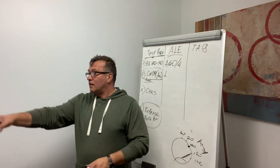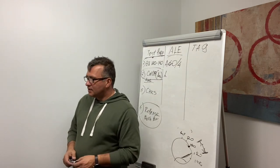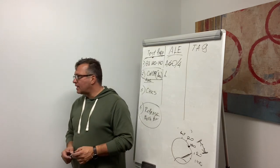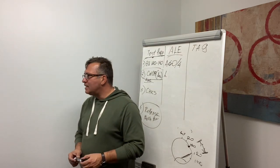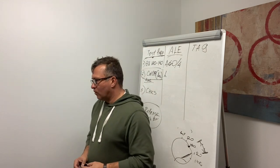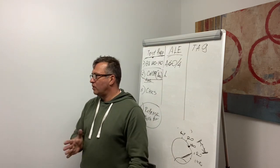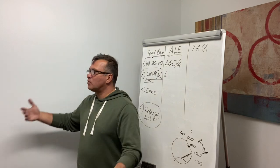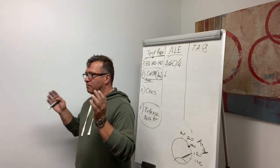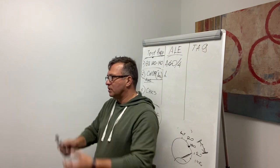The buzzer and light. Outstanding. Buzzer and light. Beep. And a light on the dash. That's the low air warning devices. Nothing has happened yet. Your system didn't engage your parking brakes yet. But it's letting you know, giving you the buzzer and light, that something is wrong and the system is losing pressure. So you need to pull over. That's the point of the system: let the driver know that you need to pull over and then perform the emergency stop. It's a breakdown, a leakage or something. Some of your hoses is broken or something.